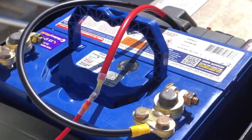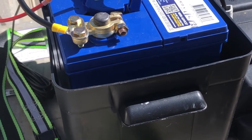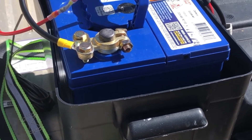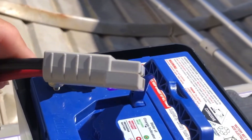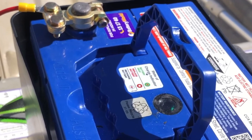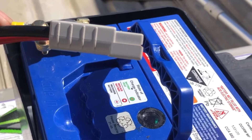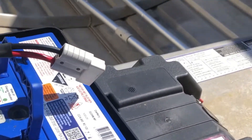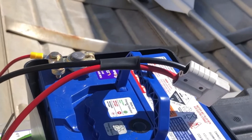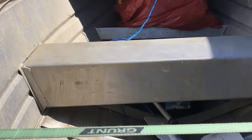Okay, so back to the installation. I've got the battery in the boat now into the battery box. That's the area where I did use a couple of screws — I've screwed the bottom into the seat of the boat, because there's a fair bit of weight in these batteries. The battery is connected up here and this is going to run back to the solar panel. What I've done is put an Anderson plug on there, which gives you a little bit more flexibility — if I don't need the battery to start the boat, I could run a little fridge off that, or if I was taking the trailer off road I could connect up a compressor and pump the tires up and down. So it just gives you a bit more flexibility and it also means I can connect the battery from the solar panel when I want to. This is the other Anderson plug that's going to go into the battery — it's rated at 16 amps — and I'll just run that up the side of the boat there, which needs to be connected into the solar panel at the front.